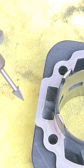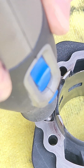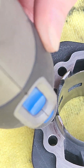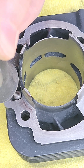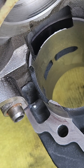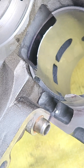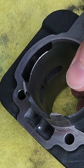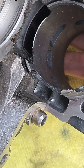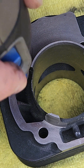Remember guys, when you're doing this kind of work it's hard to go wrong as long as you take your time. Stop regularly, put the cylinder kit back on the crank casing and just visually inspect to see where you're up to. As you can see we've started to open up those ports and get them to line up much better with the crank casing, but there's still a little bit more work we can do — and now that is looking pretty damn good.